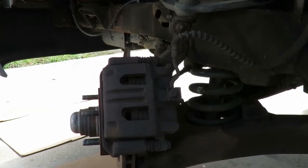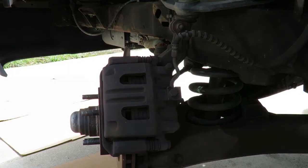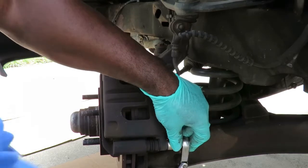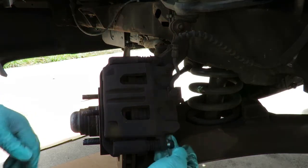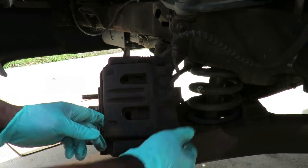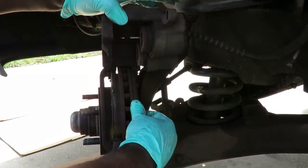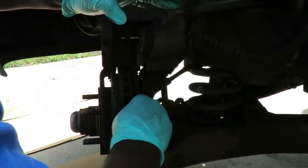On the side of the brakes, what you want to make sure you do: get a nice C-clamp, and you're going to need a ratchet with a 14mm socket. Make sure you have that cap to the master cylinder off. Right now I'm on the driver's side and I got the wheel turned all the way to the right. This is a dual piston system — the caliper has two pistons. What we're going to do is just take off this bottom bolt. Make sure you got some cardboard underneath. Take the caliper and swing it up just enough. You want to take one of the old brake pads and try to get it out of there — might have to use a screwdriver or something.